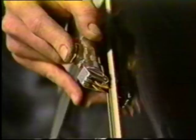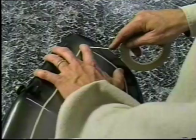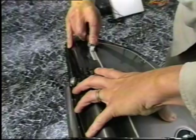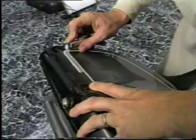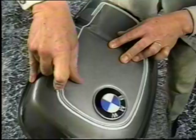A small piece of masking tape can ensure a perfect flat edge to the end of your line. Narrow masking tape is more suitable for a reference line when striping tight curves. With little effort, you can shape your tape into any reference line, then follow the path with the Bugler tool. Remember to keep your body in the most comfortable position to avoid straining. The Bugler tool will execute a consistent line weight regardless of the speed at which you stripe. So relax and enjoy. Remove your masking tape and behold your masterpiece.